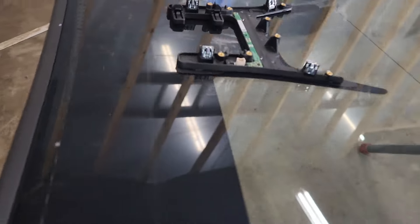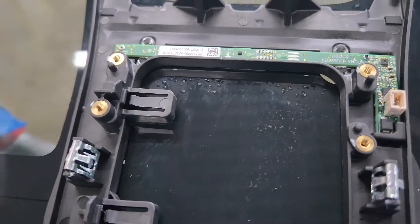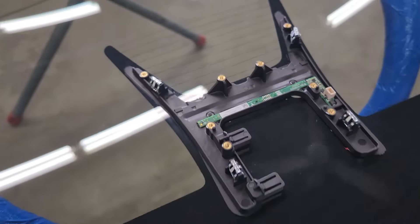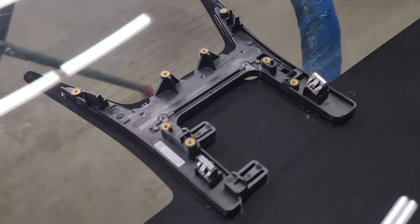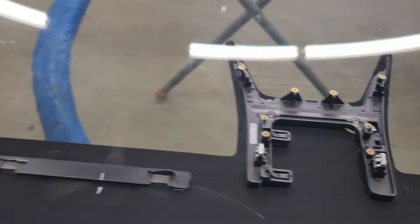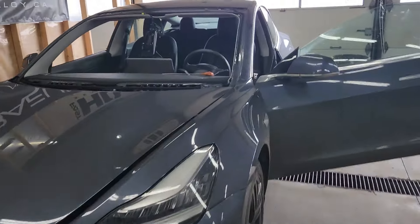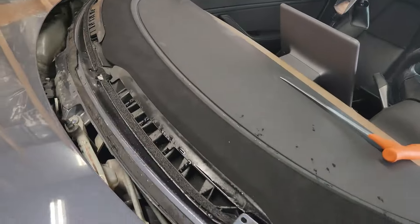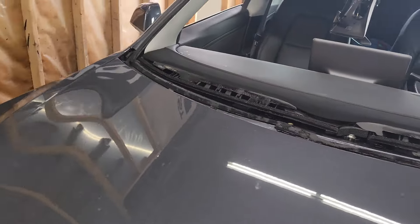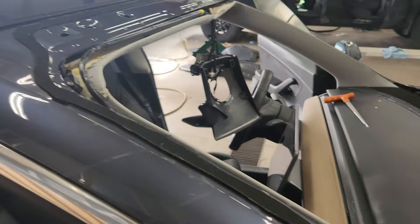Jeff's already got the new window set and ready — I missed videotaping it because it was quicker than I got there. The computer board is now in the new window and ready to go. Now it's time to prep everything. You've got to get the window frame cleaned up, cut down the old urethane all around the whole window, prime it, lay down the new bead, and set your window in place. Then set your timer and wait for it to cure.